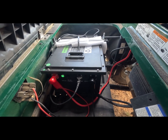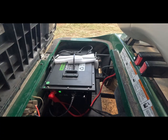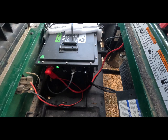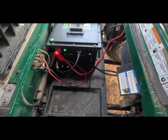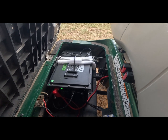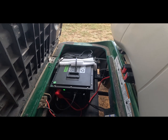Here's the golf cart battery we went with. Our golf cart is a 48-volt golf cart. As you can see, it really opens up space. We had Trojan lead acids in here — four of them. The lead acids weighed over 80 pounds a piece. This weighs just a little bit more than one of the lead acids, so we saved over 170 pounds weight-wise.